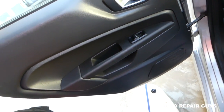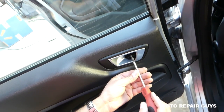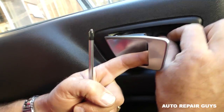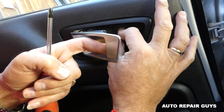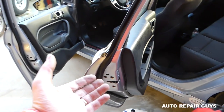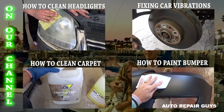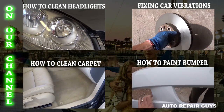Get the screw under the door handle tight — it can be reached with a power screwdriver without an extension. This one at the top is with a Phillips screwdriver. Don't forget to install the little cap — it's facing towards the opening side and goes only one way. Lock it in place, install the final cap, and that's it! That's how you remove and replace the door lock actuator on a Ford Fiesta rear door. We have the front one on the channel as well — please give a like, leave a comment, and see you next time.